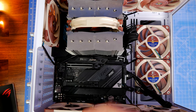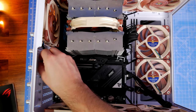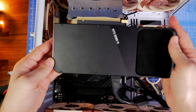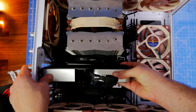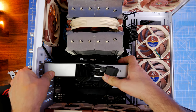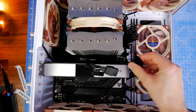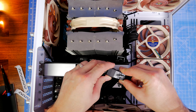To install the graphics card, remove the back plates to get access to the PCIe x16 slot. It's always preferable to use the top slot as that usually gets the fastest speeds — on this motherboard it's PCIe Gen 5, so it's future-proof. I have a 3060 Ti Founders Edition card which just slips into place. Another highlight of this motherboard is a quick release button for the PCIe slot. Use the screws from the removed plates to hold the card in place, then plug in the PCIe cable from the power supply. Some graphics cards may require two cables, so run an extra one from the rear if needed.